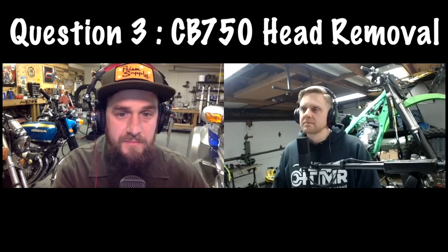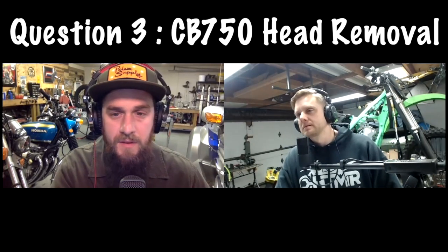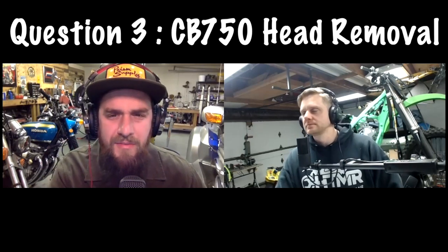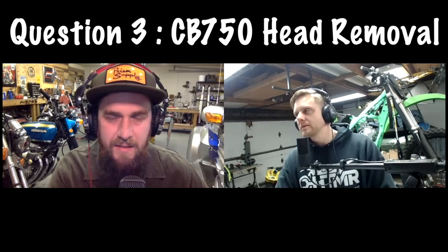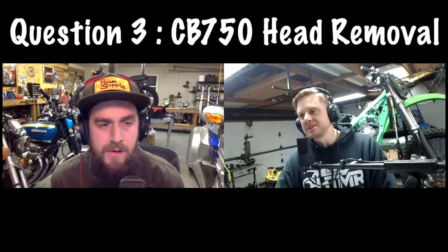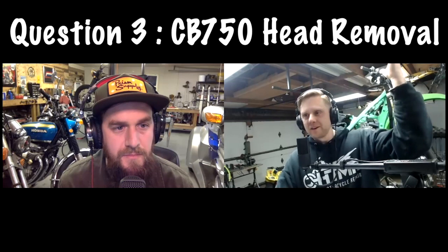So, this is a single overhead? Yes. K8. I can't remember. I've done a motor on one of these. I can't remember if that nut was an issue for me. No, so maybe it was. Hey, let me cut you short. I had a conversation with Paul. Those cam towers need to come off, and there's nuts underneath there. That's what I thought. And then when I told him that, he was like, light bulb.